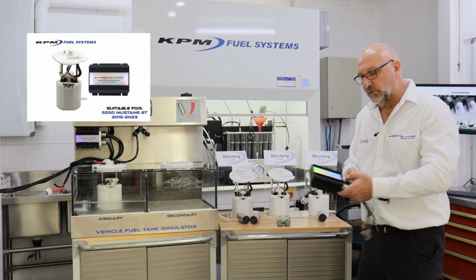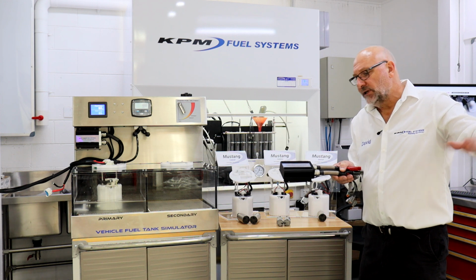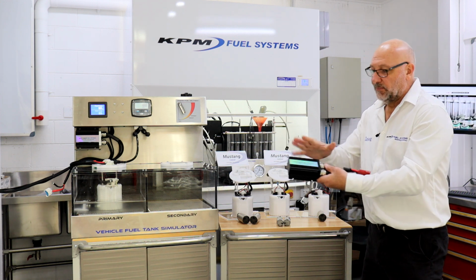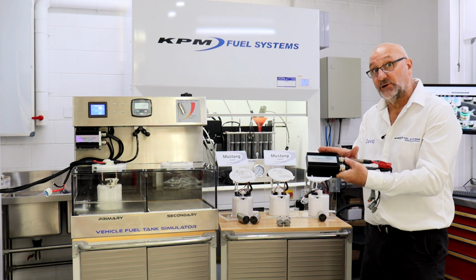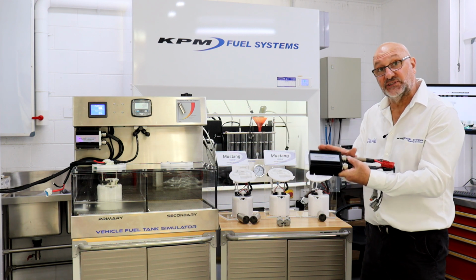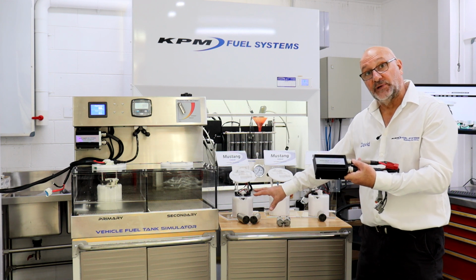With our 1500 horsepower system, this will piggyback to your standard Mustang controller, and it'll do exactly what your standard Mustang controller does, but this will handle 80 amps, whereas your standard Mustang controller will only handle about 23 amps. So it's about 4 times as heavy gauge, meaning it can run up to 4 Bosch Racing fuel pumps.